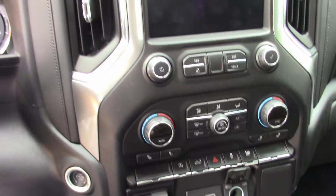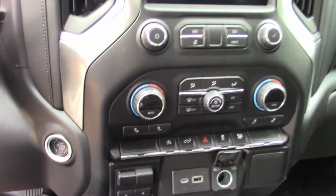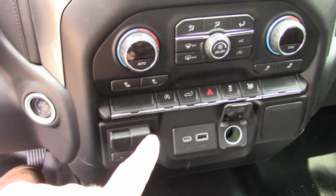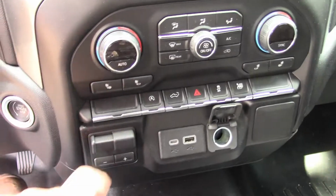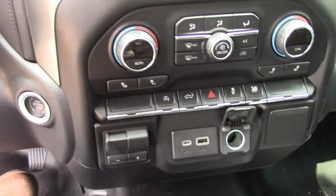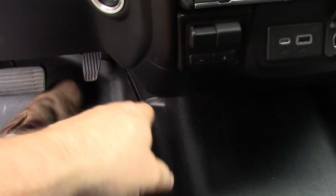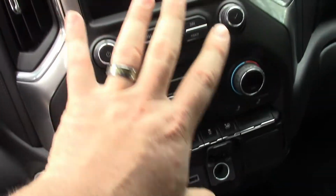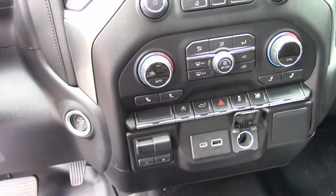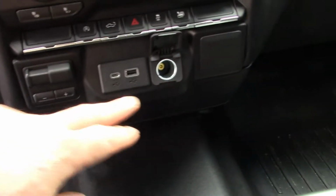And one thing I did with this 2019 Silverado, wasn't long after we got it, was put the Auto Stop Eliminator Kit on it. Basically that entails a wire that goes between this switch and the factory wiring harness, so you have to access the switch right here. Now to get this switch, you pretty much have to take all this bottom part off, the bottom valance, this part here, the trim around it, and then there's some screws, and this whole center section will slide out. So I did all that, and I did damage this part here, and I'll be replacing it.